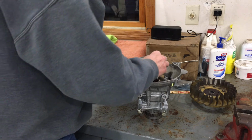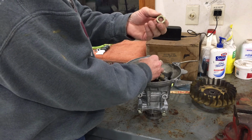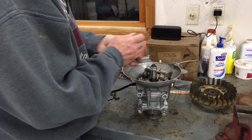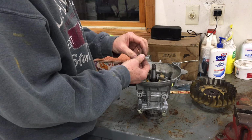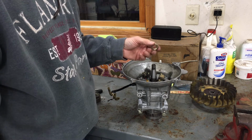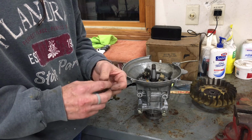Oh, and by the way, this nut, you can search all over town, so to speak, go to the bolt store, the hardware store, and whatever. The threads on it, I believe, were 16 millimeter with a pitch of 1.0. Well, it took me half a dozen different stops, and finally somebody suggested, well, go check with the auto parts store and see if they have spindle nuts.